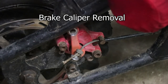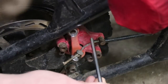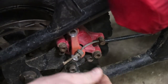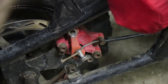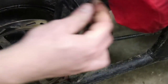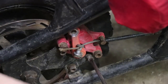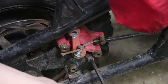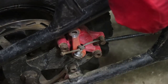One thing I want to point out here is that you'll notice where the pads actually sit behind the brake. That's going to be an issue with the hydraulic brake caliper. Even though the spacing between the two mounting bolts is the same, it's going to position the brake pad in a different spot. So we're actually going to have to do a little bit of fabrication - it's not just as simple as bolting it on.